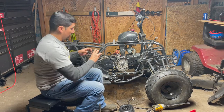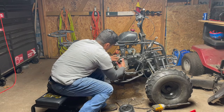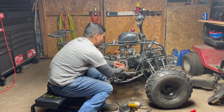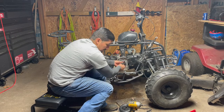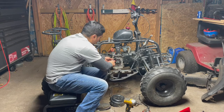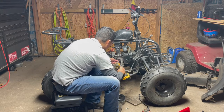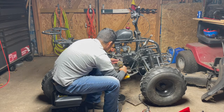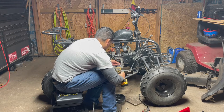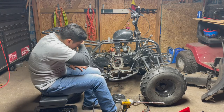Grab your new coil and slide it into place. When you're putting all these bolts back in, make sure you hand-thread them first, because if you strip one of those it's a nightmare to fix while the engine's still on here. Take pictures, or learn from my mistakes — I had this upside down; that magnet's supposed to be flipped around. Once your bolts are hand-threaded, you can go ahead and tighten with impact — not more than a couple ooga-doogas on this. That should be good. Ready to roll.